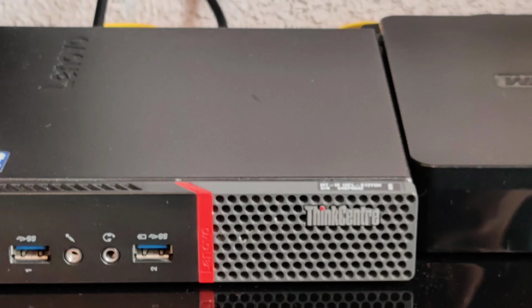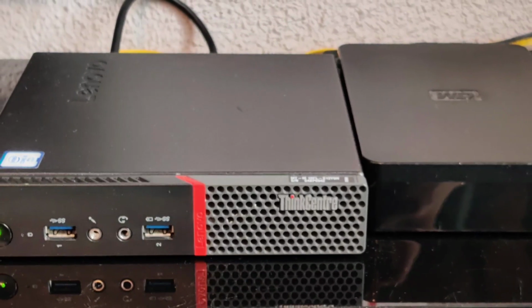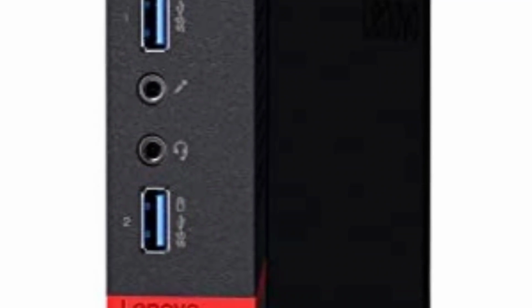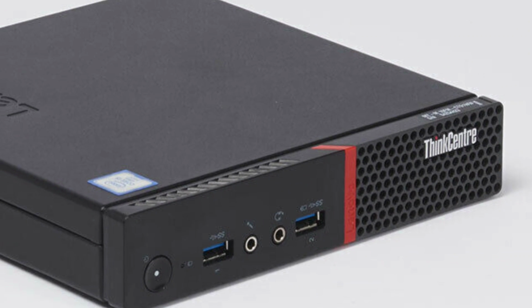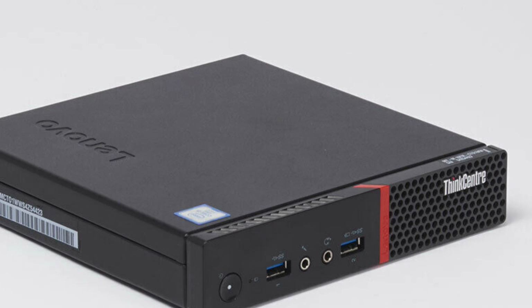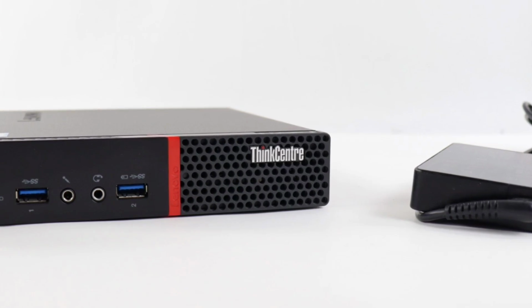On the rear of the unit, one gets 2 DisplayPort headers as standard. There is an optional slot above the NIC where ours has a serial console port. That spot can also be blank, VGA, DP, or HDMI. In our system, we have a VGA header. We also have 4 USB 3 Type-A ports. Some systems of this era used USB 2 ports, so this is a nice upgrade. There is also a small headphone jack on the bottom row of ports.